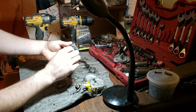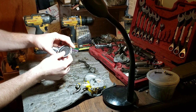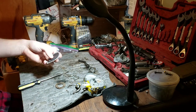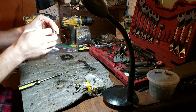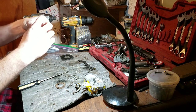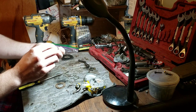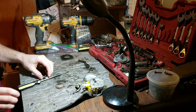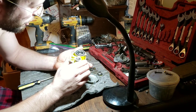It's made a little flexible — took up a little bit of slack in this. We'll just run it and see where it goes. If there's any problems, fix it. There we go. At least that's that plug. To get the carb back together — it wasn't bad. All I did was take a little brass dremel brush, put it inside the drill, and got a bunch of the gunk and nasties out.